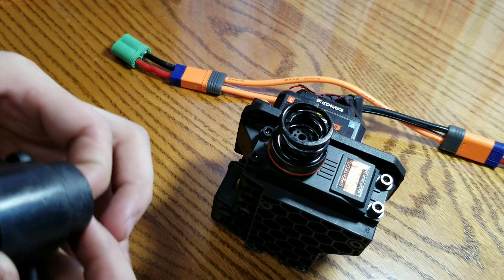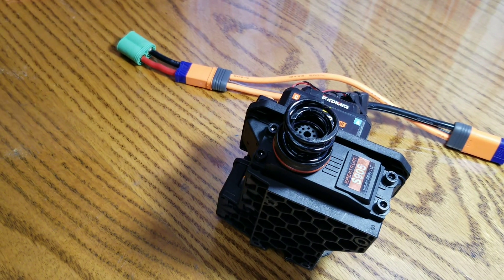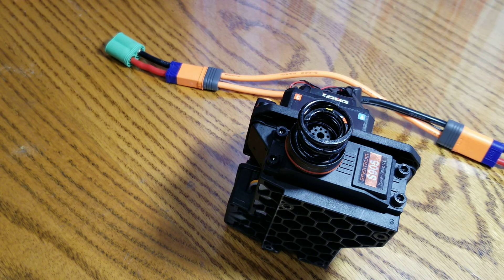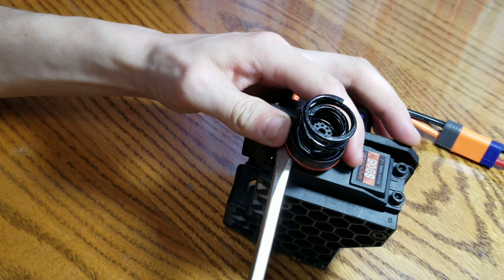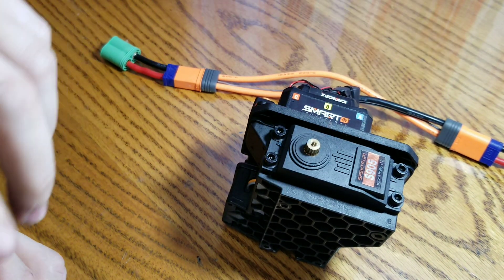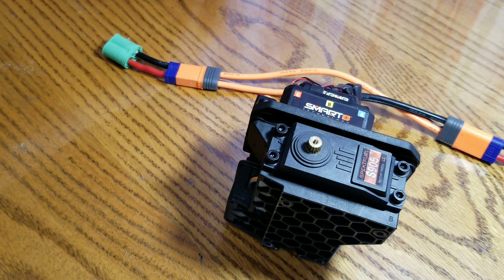That's what it looks like on the inside. Being very careful — there are little splines in there. You want to be careful not to mix those up. Now you've got two springs in here. I'm going to rock this off — maybe just use a flat head. I'm surprised I didn't get bombarded with Loctite because my brother Poison RC's was completely locked. Check your splines — see how mine all look okay. That's luck.